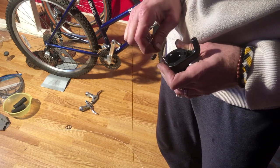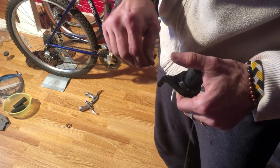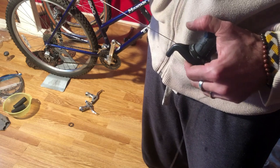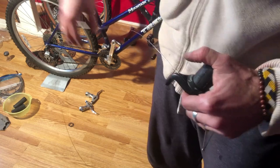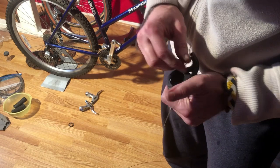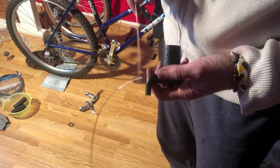A quick cable installation tip: don't remove the housing when reinstalling the cable, but remove the steel ring inside to insert the cable. The reason for this is that it took me 30 minutes with the help of an official video tutorial to get the thing back together again. It's probably me, but it was very frustrating nonetheless.